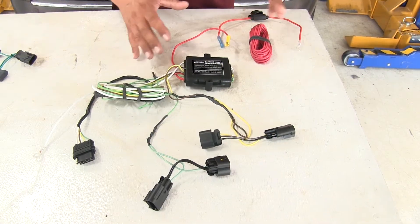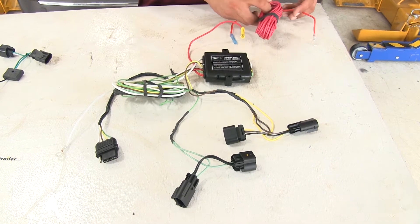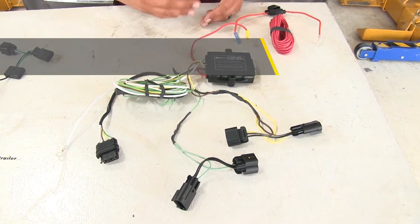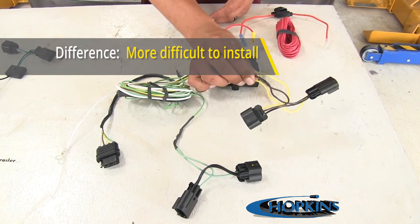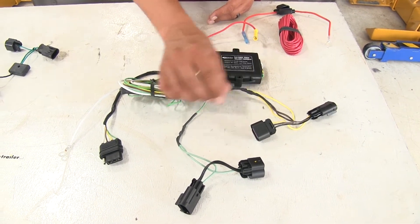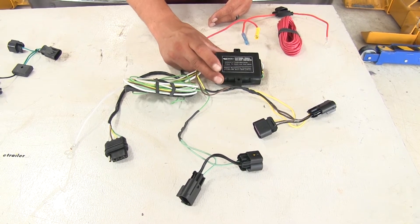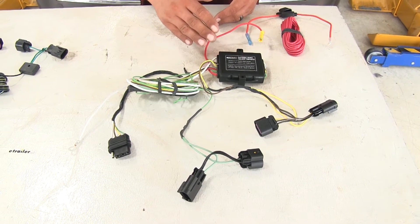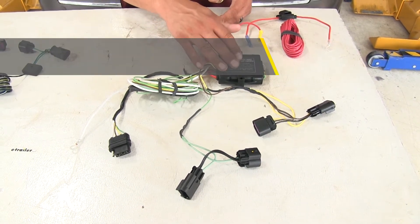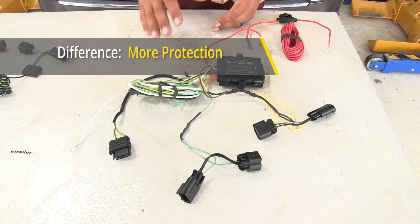With our Hopkins you can see that it is a much larger wiring harness, and there are a few extra pieces with it. Now the installation is going to be a little bit more in depth, but the basic part is going to be the same. We're still going to have those T-Connectors that are going to go in between our tail lights. However, we're going to have a powered tail light converter, which is going to take that signal and turn it into a working signal for our trailer, while also protecting our vehicle to make sure that we don't have any kind of back feeding if anything were to happen to the trailer side.